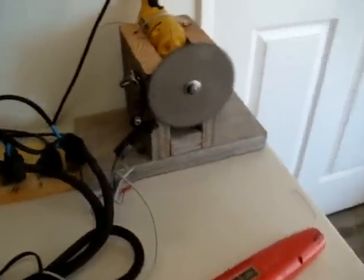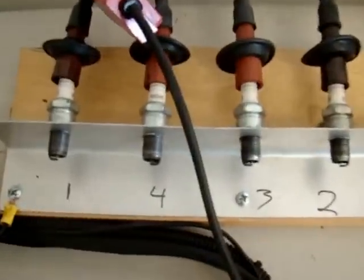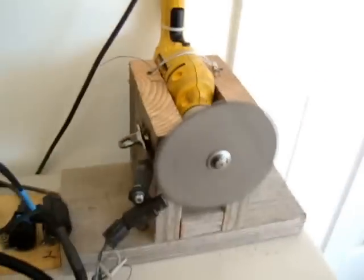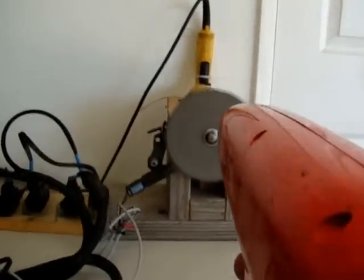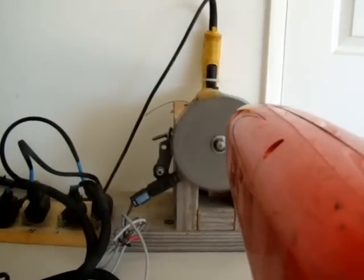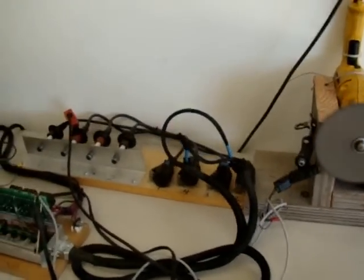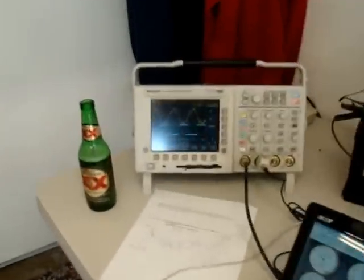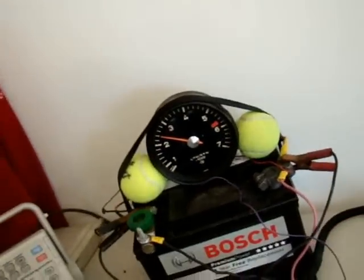So we've got our little wheel turning here. We've got some sparks flying — looks good. I think I set the advance properly, right in line at 120 degrees. So that's all good. I think I got the slope right on the waveforms, and even the tachometer works. It's all good.